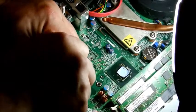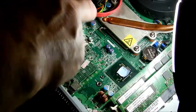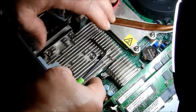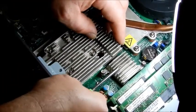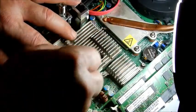I really don't need the hard drive in to test this — I just need the heat sink put back on the video card and I can see if something comes up on the screen. The heat sink goes here: line that up, this one goes on top of that one, slide it underneath straight down on top of wherever the screws go. Look for the screw holes and line it up — they're not going to go in unless they're lined up. There we go — it seats down nicely. The two screw holes on the video card are now visible.